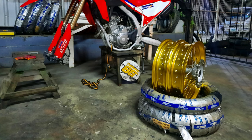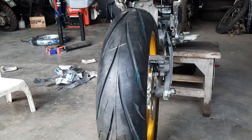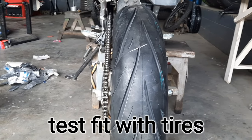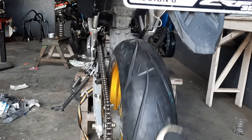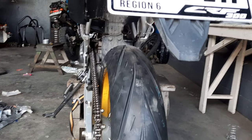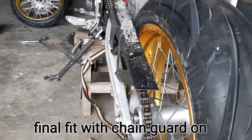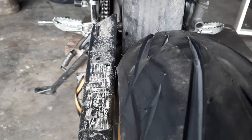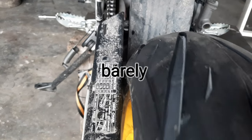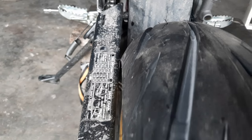The rims are done and are perfectly aligned. The test fit shows that I have enough clearances between the forks and the swing arm. For tires, we will be using IRC Exato NR88s. These are my best-selling tires here at the shop since they offer excellent grip, cornering stability, and decent tread life at a very low price. For the lower fork guards, you will need to trim it a bit to make the clearances and transfer the brake hose to the outside. As for the back, you might need to trim the stock chain guard to avoid it from rubbing the tire.